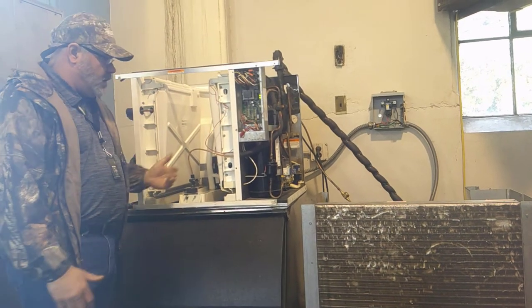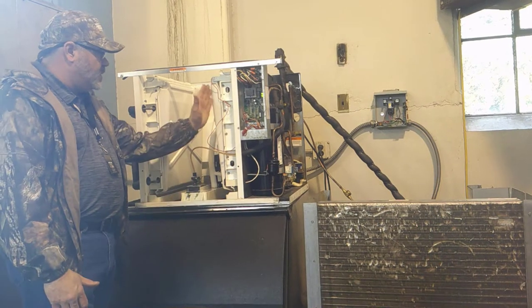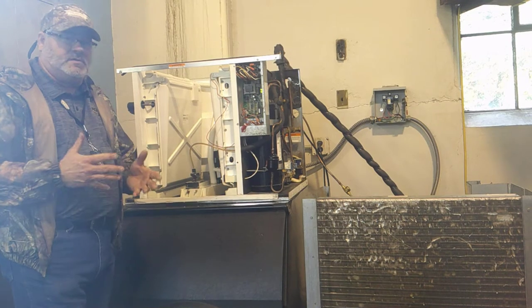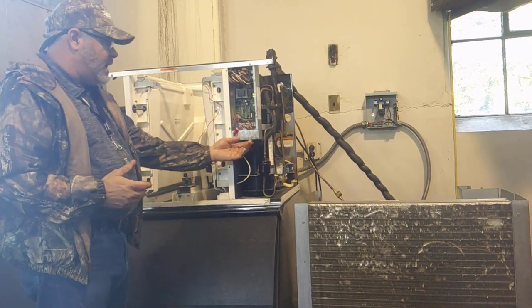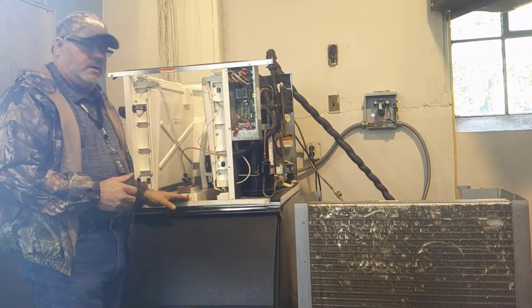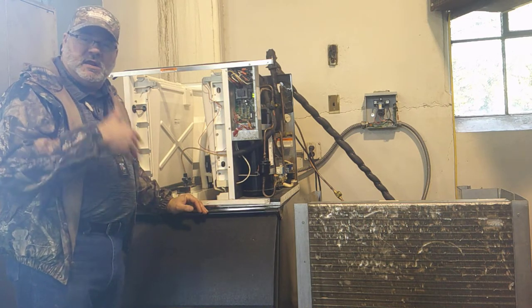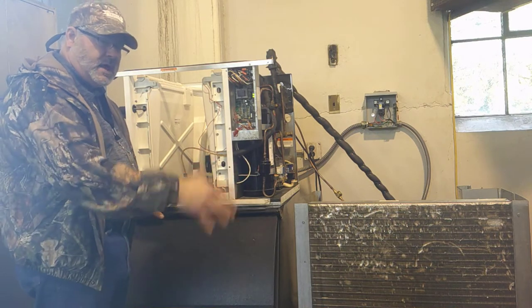This section here is called the ice head. This sits on top of the bin — this is where the ice is actually made. The first thing in its sequence of operation, when we turn the power on to this machine, is it's going to empty the reservoir of water and go down the drain. It's going to bring in fresh water and flush any contaminants or dirt that may be in the water reservoir.